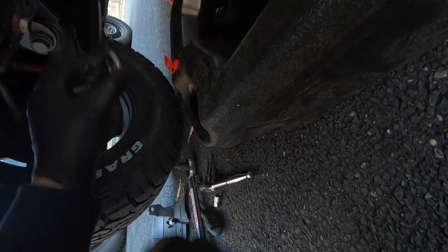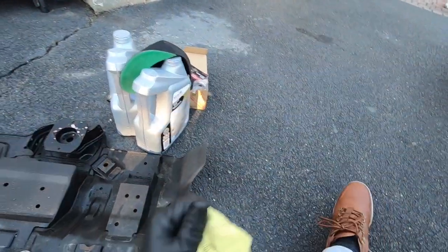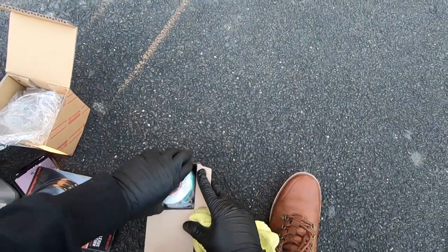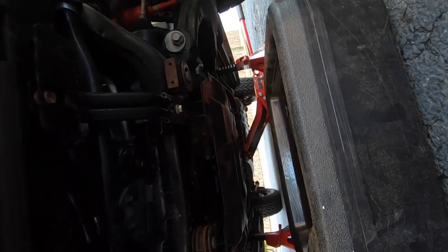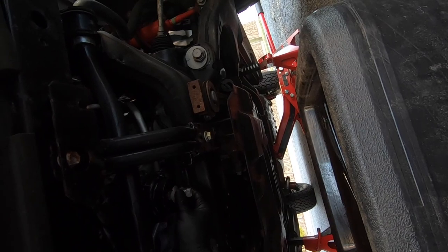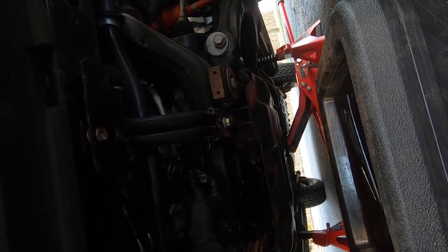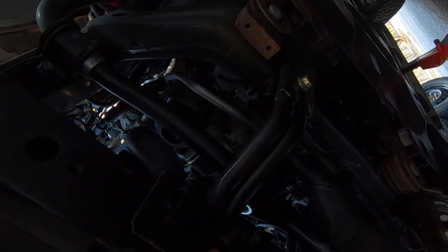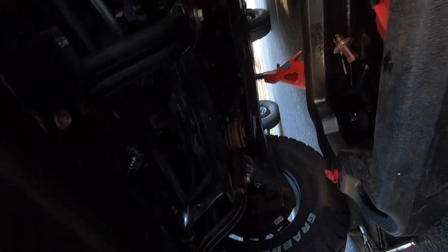This little cap has an O-ring — you want to replace that O-ring right there. Get your new TRD filter; it came with this little plug. What you have to do is stick this plug in here, and once it goes in oil should start coming out. Looks like it's basically done draining — yank this guy out once it stops dripping.